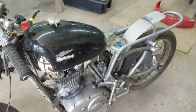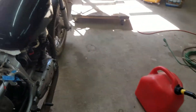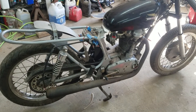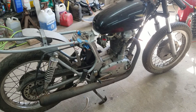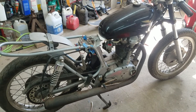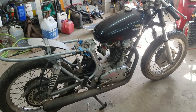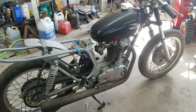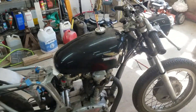When I bought this bike — and it turns out it was 10 years ago — I was told that it was a freshly rebuilt motor, and it completely acts like it. It's a very tight motor, it makes no smoke at all. I was amazed when I started it and there was just no blue smoke, no nothing. There's no rattles, no odd sounds — it really is just a tight, fresh motor. You can see when you kickstart it it's a little bit of work, but the good news is it really starts well and runs better than it did when I bought it, because I believe the ignition was way too advanced.